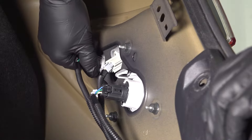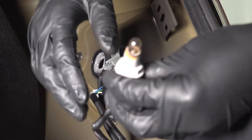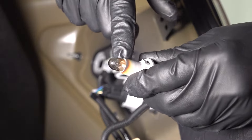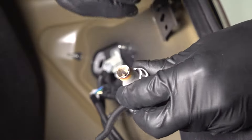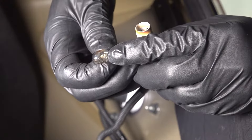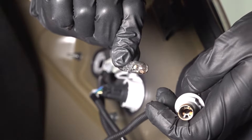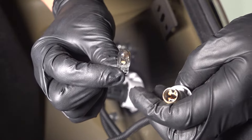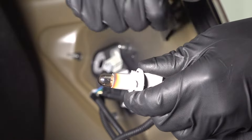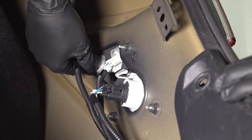Lastly, we have this small marker light. Turn it counterclockwise and remove it from the taillight. This is just a small 194 bulb. As you can see, even though it is small, it did somewhat melt and burn the socket. I'm going to thoroughly inspect it inside, and it does look good — so it's only on the outside here where the bulb gets really hot. You definitely want to inspect and make sure the rest of the socket is in good condition. This is a 194 bulb, so make sure you have the right one to install. Take your new bulb and slide it into the socket. I'm reusing mine for the purposes of this video; however, if yours is the same, consider replacing it. Line up the bulb with the taillight assembly and lock it in.